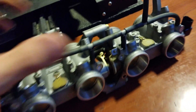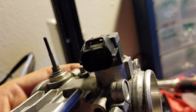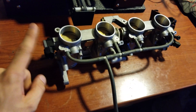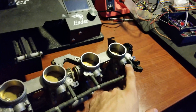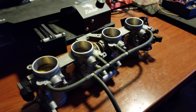Right over here — which was somewhat hard to see in the car — we have the throttle position sensor mounted on the main throttle plates. It's just a regular 3-pin, 5-volt throttle position sensor. If you purchase these individual throttle bodies off eBay, you'll hopefully find a set that has one of these attached already, because that's what I was able to do. You can also see the vacuum lines a little easier here — it's basically one port for each intake runner, which gives you a better vacuum signal so it's not pulsing as much.